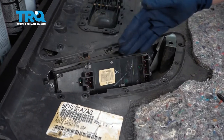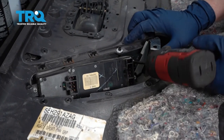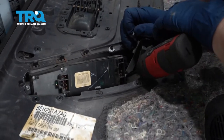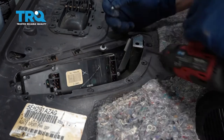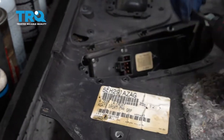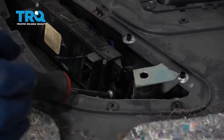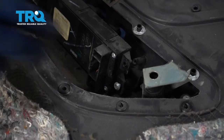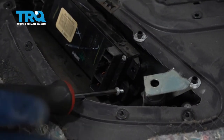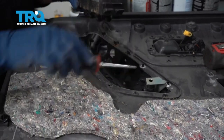To dismount the main window switch from the driver's door panel, once you take the panel off you'll have access to the three mounting screws. Phillips head screwdriver — we're just gonna take this off. This one's a bit of an angle, let's get the top one first. I just moved over to a manual screwdriver just to get in there a little bit easier. Once you can remove that — there we go — just lift the whole switch out, make sure you don't lose the screw, and there it is.